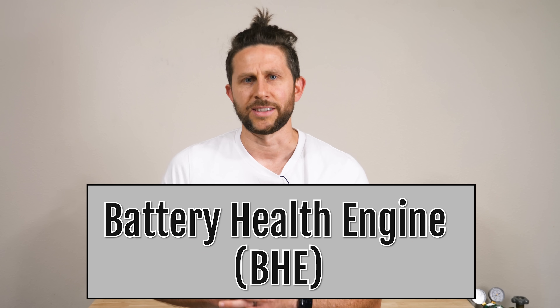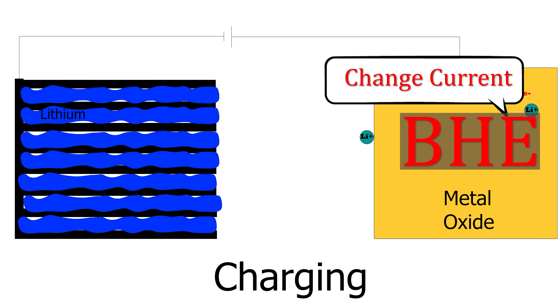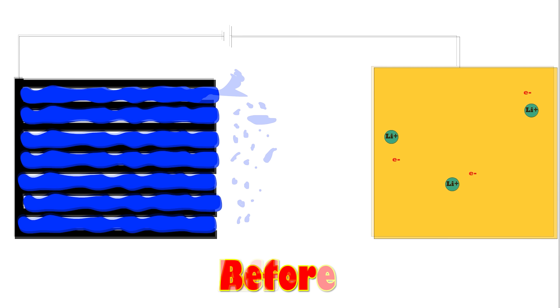But wouldn't it be nice if there was a phone that actively monitored and took actions against dead lithium forming? Well, there's a company called Oppo that sponsored this video, and they created a technology called the Battery Health Engine. This is specific software that monitors the potential on the negative electrode, which is a key indicator of the condition of dead lithium inside a battery. This allows for real-time feedback of the voltage and current on the negative electrode, which the Oppo Battery Health Engine can use to adjust the charging current and voltage to a suitable level — reducing the formation of lithium branches and eventually reducing the number of dead lithium. The software can do this for different battery capacities, charging adapters, battery states, and charging stages by accurately judging the negative electrode potential.